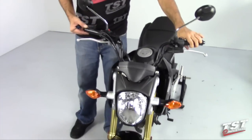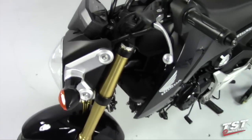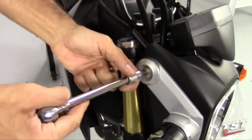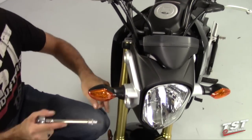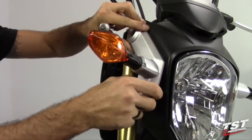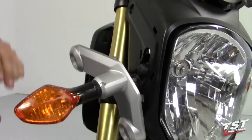In the first step we will be removing the Phillips screws from behind the signal pods — there's one on either side of the bike. Then we will need to remove the top bolts. With the bottom screws, what I like to do is take them out one by one, remove this boomerang-looking part, and then screw the bottom screw back into the screw boss. We'll do that same procedure on the other side.